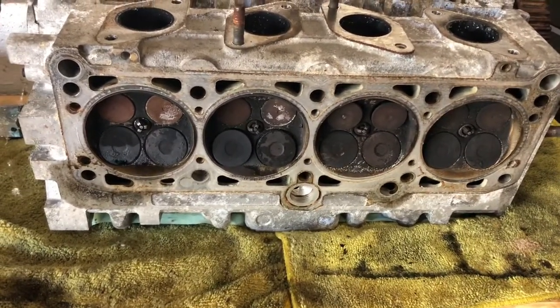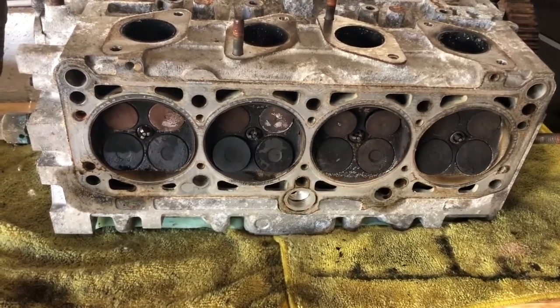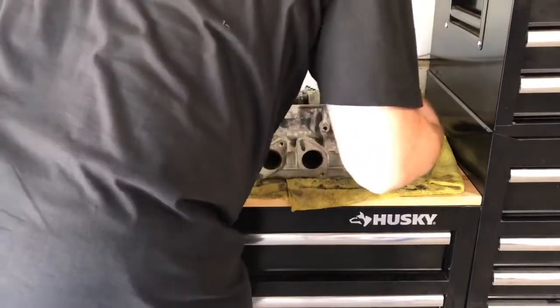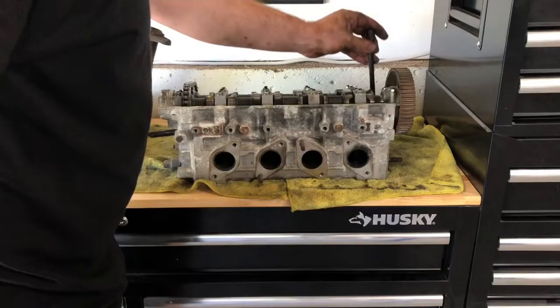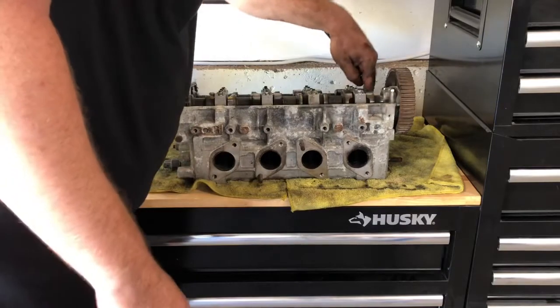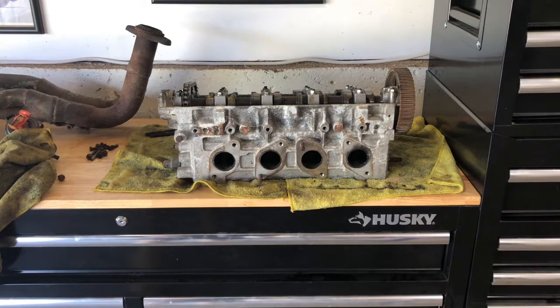I do think they cinched down the head bolts on the two ends way too tight because there was a bit of surface pressure caused by the, how do I explain that best? Take a head bolt and put it in and out of one of the holes, it's hard to get in and out, so I think they've crushed it a bit more than it needs to be, so now it's shrunk in the top of the hole, and it's only right at the top. So I might have to just lightly ream that out to get it to run really smooth, but everything else on the head looks really good. I'm going to do something similar to what I did to the block to make sure it stands the test of time while I wait for parts, so let me get that done.